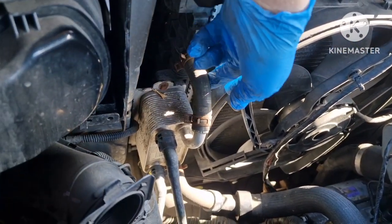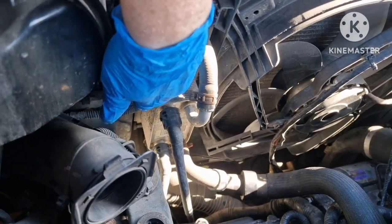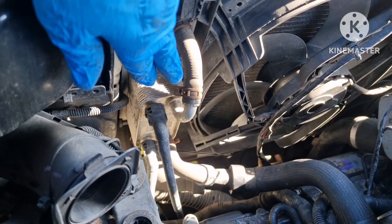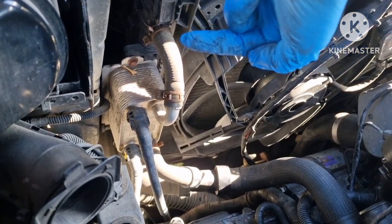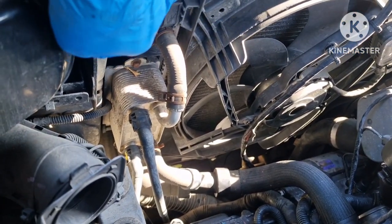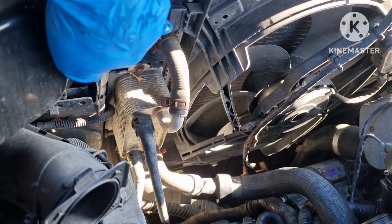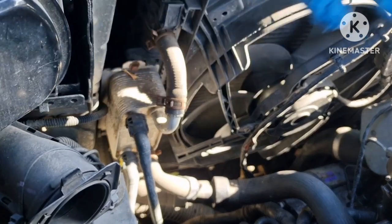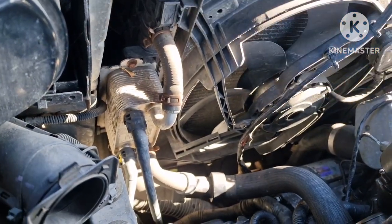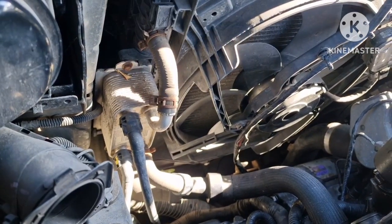Unless you want to take off this oil cooler, it looks like, or power steering or gearbox cooler. Right, when you put this fan unit in, you've got two tangs. Obviously, one is my favourite word, tangs. Right, one there, a little tab sticking out, plastic tabs that hook into that. There's also one in the bottom as well. Now, when you put this assembly in, put it in with this side down, so it wants to be about 45 degrees.